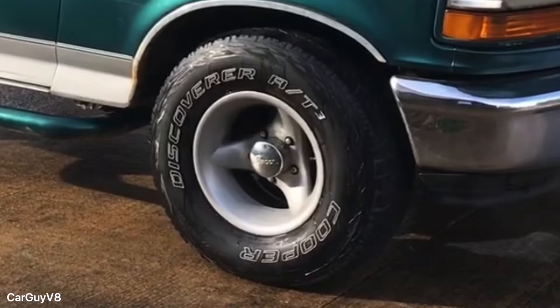So that was my starting point with this truck. Using my editing software I was able to determine the exact start and end of the run and it came out to 8.6 seconds. This was using 30.6 inch tall tires all around — Cooper Discoverer AT3 265/75/15s. And even though the truck had a 3.55 rear gear, it acted like it had significantly taller gearing due to how tall these tires were.